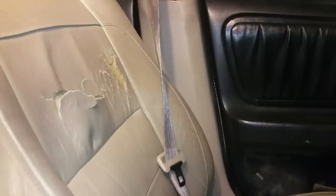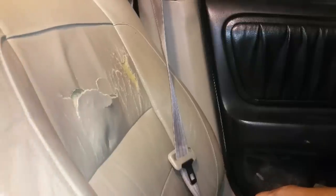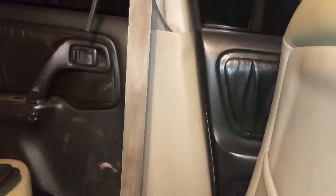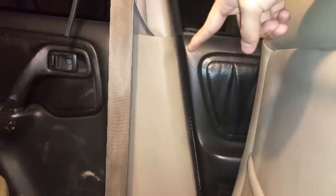What we're going to do is move our seat forward as much as we can so that it gives us a lot of room and access to the seat belt itself. Now you can get a better glimpse — you can see on my seat belt right here it's twisted, and that's also causing it to not retract as fast. To correct that, you usually have to unbolt the bolt on the bottom and orientate the seat belt in its correct position.